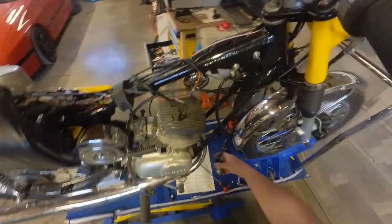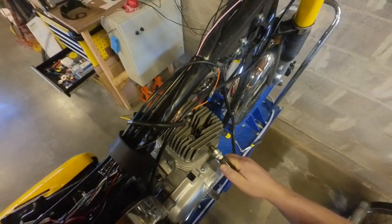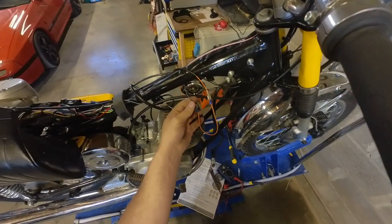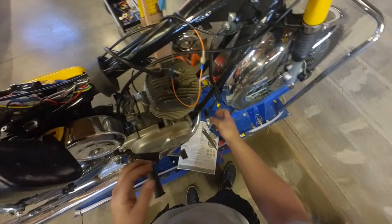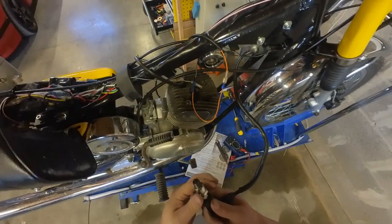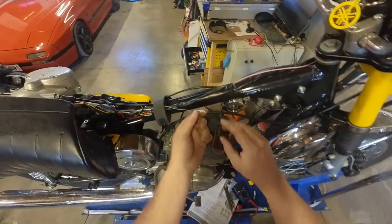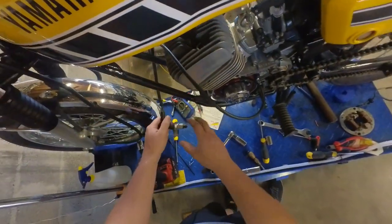Just temporary to see if we have spark and if we can get this thing to fire up, then we can mount everything properly. Let's see if this thing will spark. No, nothing. Why not? Wrong wire - I've connected the wrong wires. Apparently there are two black and white wires on this wiring loom. So now we have the orange wire from the CDI connected to the coil. Hopefully we get some spark now - we get spark! It's a small spark, but maybe that's because... Let's actually put the gas tank back on and see if we can fire this thing up. We got fuel flowing, let's put the spark plug in and see if we can get this thing to start.